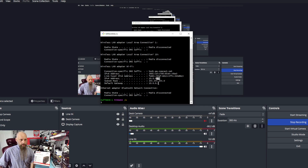Ending in .1 is usually going to be your gateway, but it's not necessarily always the case — your gateway can be under any IP address. You're going to see it listed right there: Default Gateway is our router. So this is our router. Now why do we need this address?